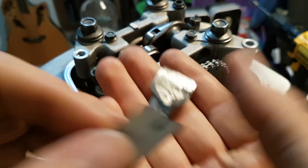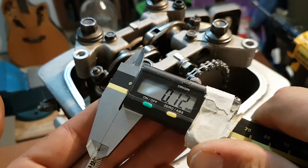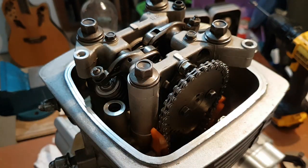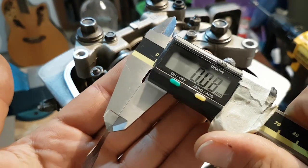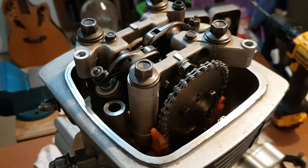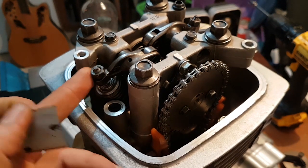Yes, they look very crappy, but let me show you if they are accurate. As you can see, if my caliper is accurate, the thickness should be accurate also. That was the exhaust, and this should be the intake — 0.08 as I said for the intake. So if you have a caliper, you can make your own feeler gauges.